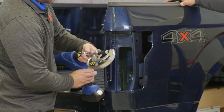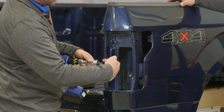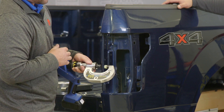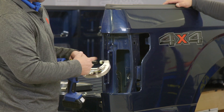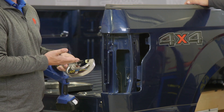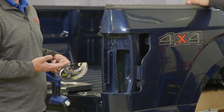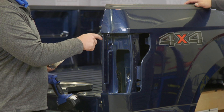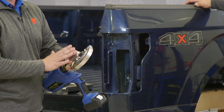Looking at the ProSpot PR5 removal tool, it has a male end and a female end. If you pull the rubber off, you can see the little male end that actually punches the rivet out. The Delrin spring on there helps prevent the tool from breaking — SPRs in the collision world are very hard to remove and many companies have issues with dies breaking. That leads technicians to try a belt sander instead. Many OEMs say that's okay, but the self-piercing rivets are boron steel, and grinding that into an aluminum panel could cause galvanic corrosion and future problems. So we want to use the removal tool.